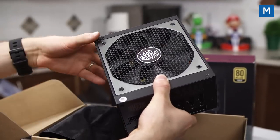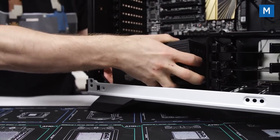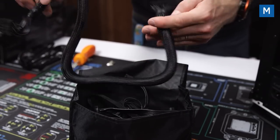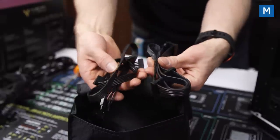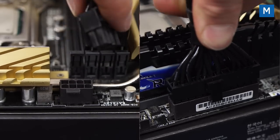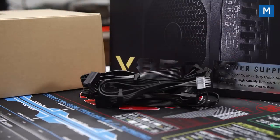We're using a modular power supply, so rather than worrying about cables right away, we'll just slide the PSU into position fan-side down at the bottom of the case where there's a filtered intake, then use the four included screws to secure it at the back. Grab the 24-pin cable, 8-pin EPS cable, two PCIe power cables, a couple of SATA power cables, and a 4-pin Molex cable — this should be enough to power the whole system. Plug the 24-pin and 8-pin EPS connectors into the motherboard and route them behind the motherboard tray through the nearest holes.